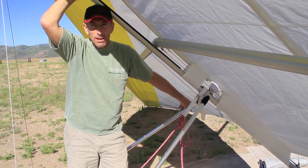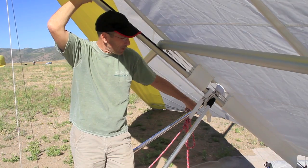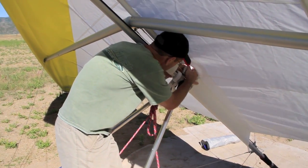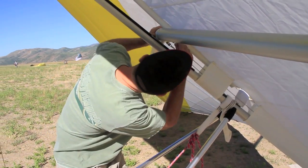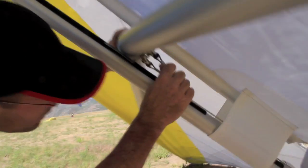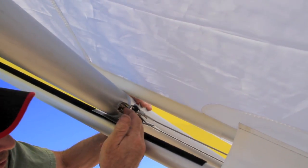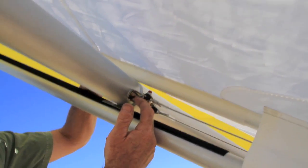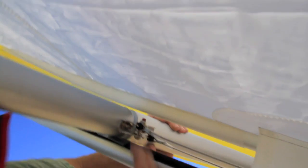Even if you leave your glider tied down and walk away, when you come back you should at least walk around really quickly. Check the control bar, the king post, your hang loop. These brackets right here — you can see the balls are engaged. The sweep wires have a hinge bolt right here, and then there are two bolts whose heads are actually inside here, but you can see the nuts on the back side. Just check this whole assembly.